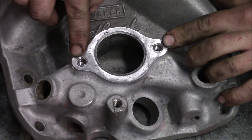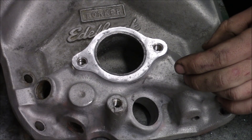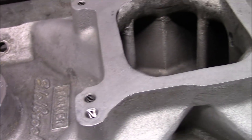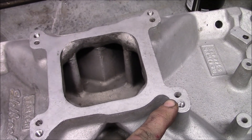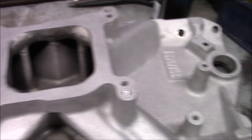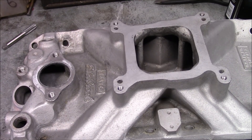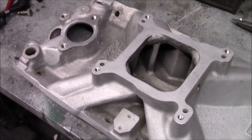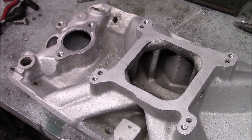I've done the rest of the holes. Here are your thermostat holes, and I just have to do the carburetor mounting holes and the plate up here and this intake's good to go. Here's your finished result — you can see the thread inserts are in there, nice new threads. Carburetor mounting flange, same thing. I only drilled the outer holes because the Holley carburetor I'm using only uses the outer holes; the inner holes are for older Carter carburetors or something. This will pertain to pretty much any metal thread repair using Helicoils. It's somewhat easier in aluminum, but you can use these in steel or whatever. Hopefully that helps — thanks for watching, you can click subscribe below.